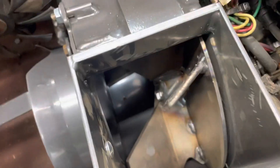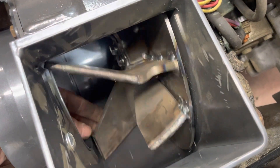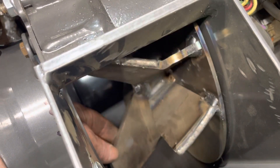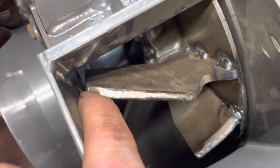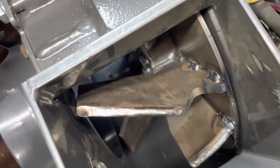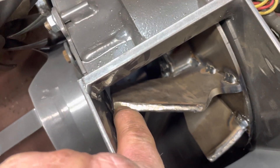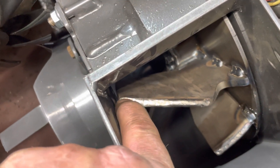What I did is I took this thing and I spun it. And you can see the fins — they weld them right on top there. I kept going, trying to find where it was hitting. I had to grind at the top of this fin. It was hitting right in here — they made it too long or put too big of a weld on it, and it was hitting back in this corner where you couldn't really see it. So I ran it for a while, it made a mark, and I took my grinder and ground this one end down just so it would clear.